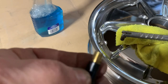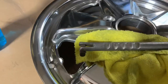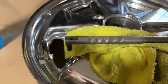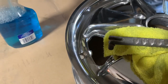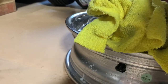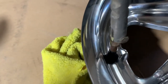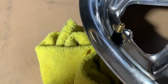First, put your valve stem in. You can grab it with needle-nose pliers or use a valve stem puller tool from AutoZone. Slide it through the valve stem hole, give it a little lubricant, pull it through. Lubricate, slip through the hole, use a protective towel so you won't scar your wheel, bend it over and give it a snap - and we've installed the valve stem.